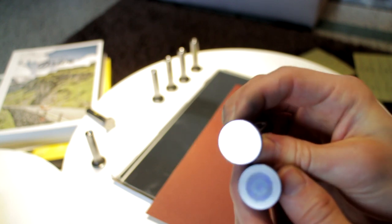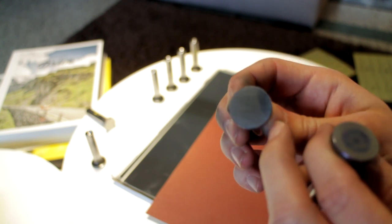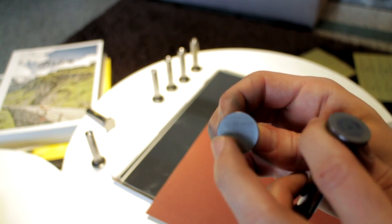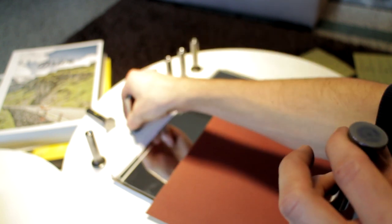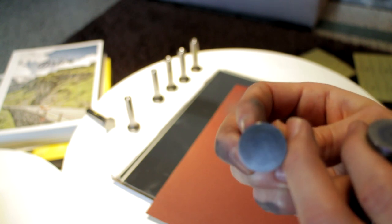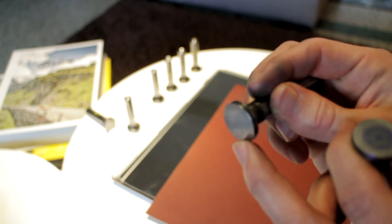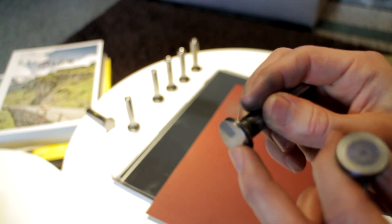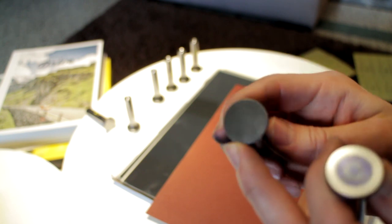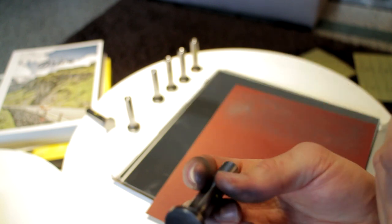This one I did later and you can see it's flat — we still have one spot in the center but it's sanded off, and you can see the circle underneath has a different color but it's completely flat. On the first one I sanded until most of the color was gone, but reflecting it against the light I can still see it a little bit — I had to sand off more than I'd like to get it completely flat. I should get these tested for hardness to make sure they're still okay, otherwise we need to get these hardened again.